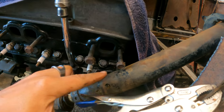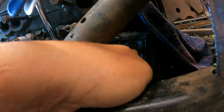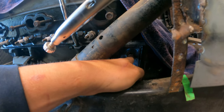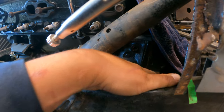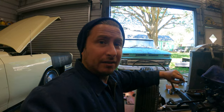This feels a fuzz tight on the exhaust, and that's fine. It can go down a little bit and that won't affect that part, but what it will affect is I need access to this bolt hole right here, because my goal is to run the bell crank for the clutch off of this pole. So I'll pull something here, run across, mount here, and then the clutch pedal will push this down, which will swing under and push that back. It might fit. I mean, for this area of a hot rod, it's fit or don't fit, right?